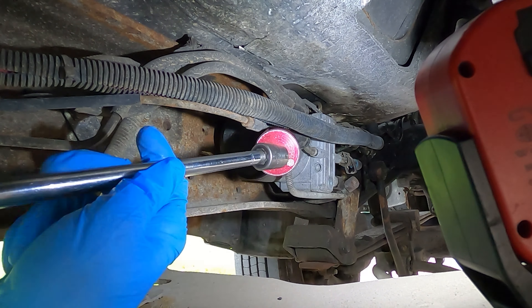Just breaking it loose — you can see that gap starting to split. I'm going to do it by hand. You can see the fuel starting — we are in the splash zone, just be prepared to have fuel coming. I'm going to jiggle that cap. There we go — just take it all the way off and let it drain. Then you can get the cap and tooling out of the way.